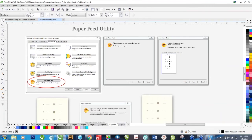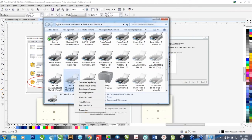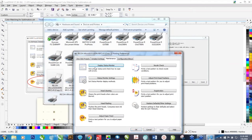How do we resolve that one? You would go into your utility, but this one you would go into the Ricoh or the Sawgrass utility. Go into your Devices and Printers and you're going to look for not the Power Driver, but one of the Ricoh drivers. If you go into printing preferences on the Sawgrass printing preferences, you're going to see the Maintenance tab, where all these options are. You also have head cleaning options and head flushing options. By the way, head flushing — don't recommend until you are exhausting all other avenues. Call us first before you do head flushing. It uses more ink than what you may need to use. The Adjust Paper Feed is right here.